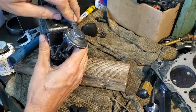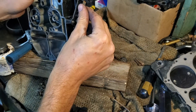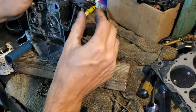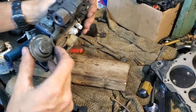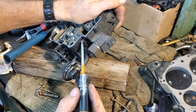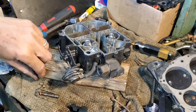These two little metal tabs you have to kind of bend open if you want to pull that out, but as long as this pulls back at idle it's working. If this doesn't contract when the motor is idling, then it has a leaking diaphragm and you need to replace it. This little port over here is a threaded barb for the fuel pump overflow — it's not currently connected but we'll put that in later.